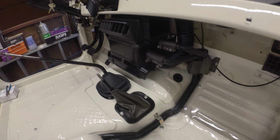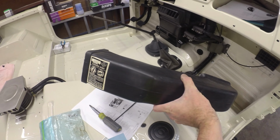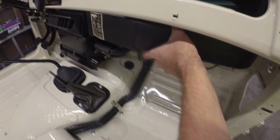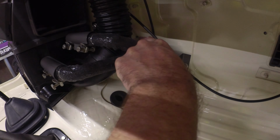Well, heater's all dunked back in, nice and clean. Hoses are all bundled up, tucked in there where they need to go. I do have this air duct, basically it goes kind of up there like that, tucks in, basically drives it from the fan on the firewall up over to the heater core. Just a couple bolts, so he's pretty minor. But if you notice, there's one little guy right back there, and that is the mounting strap for the little vent tube that comes from this guy that runs down to this hole. I can still get up in here to get the vent tube on, or the drain tube, but I will probably need to keep access to get there. Technically, you could kind of get with that duct in there, but you might as well leave it off, make your life a little bit easier.